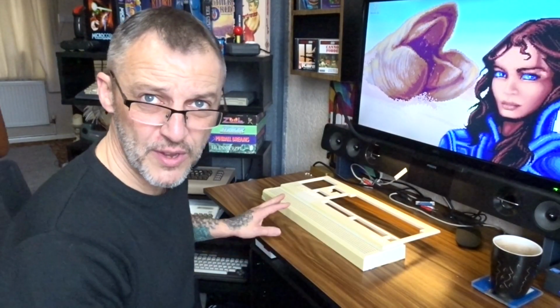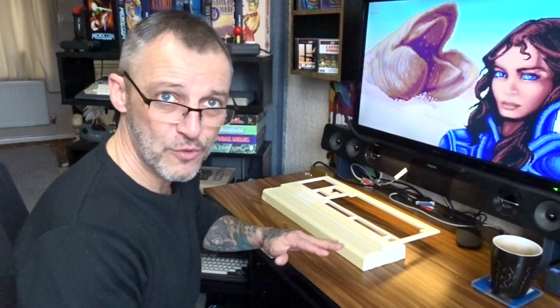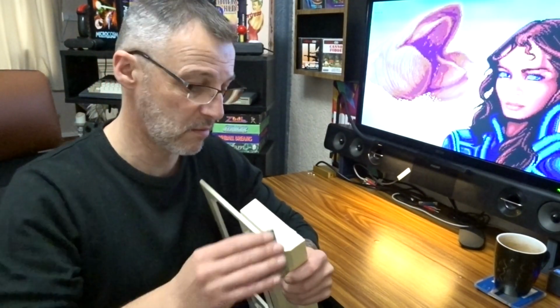So what we'll do next, we'll sand it down, get it into that shape, then we'll just scour lightly over the whole thing, just a key for an undercoat. Then let that dry for 10 minutes, then we can put the top coat over the top of that. So it's a 600 grit. You don't want to go too rough on it, so just take your turn.